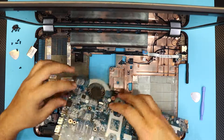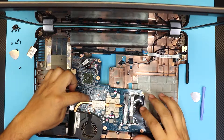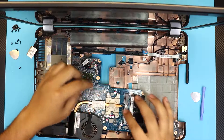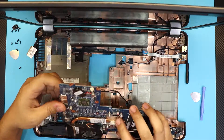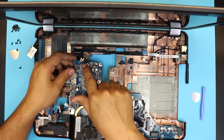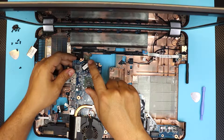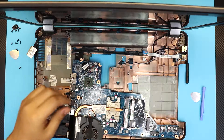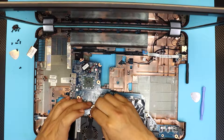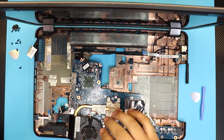For cleaning the motherboard, flip it over. This one does not have a dedicated video chip — some do come with it soldered on the board. This is your BIOS battery — if it doesn't hold the BIOS configuration, you can replace this battery. First, remove the fan cable, then remove the heatsink.